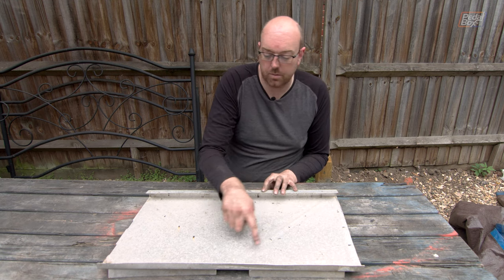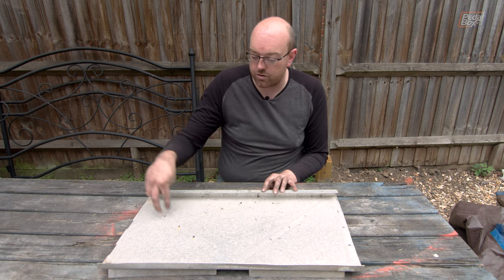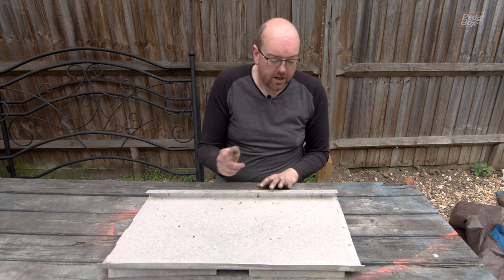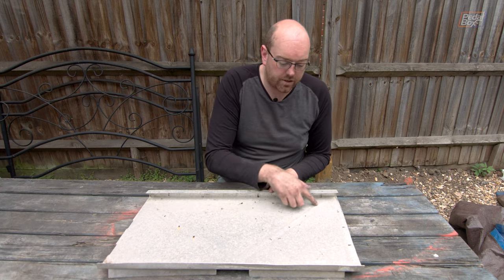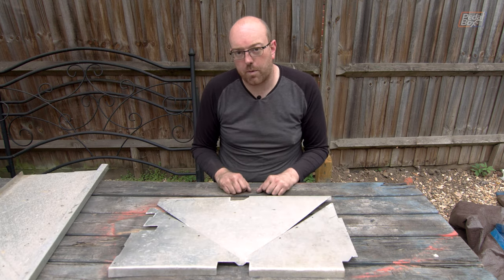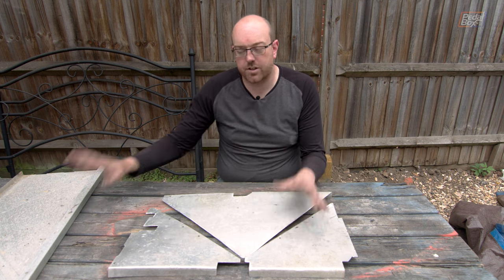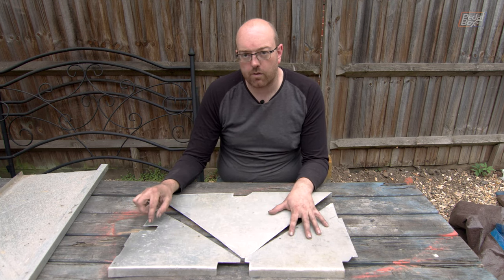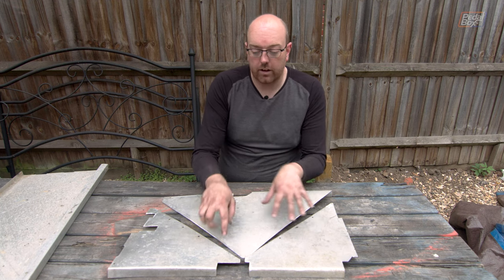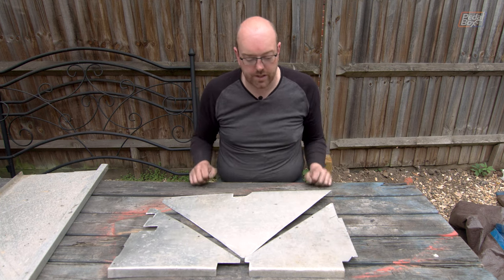You can see it's been pre-drilled so it would just be pop riveted straight onto the chassis, and it actually has all the lines drawn on for where the cross braces are — obviously to drill the holes to pop rivet it. What I've done with the other one is slice down these lines to make it into three pieces — here's one I prepared earlier. The three pieces: this one goes on the driver's side, this is the passenger side just reversed, but this has a cutout to go around the intercooler mount at the back and part of the trailing arm mount, and also some cutouts at the bottom to go around the floor superstructure so it all fits in nicely.